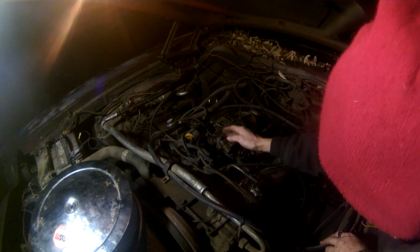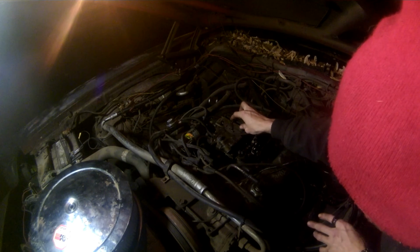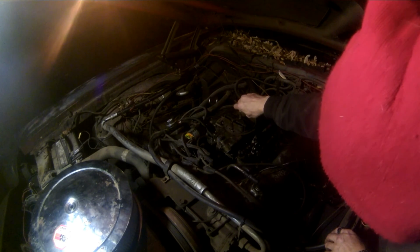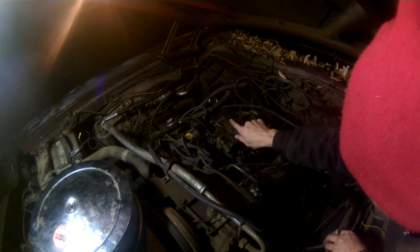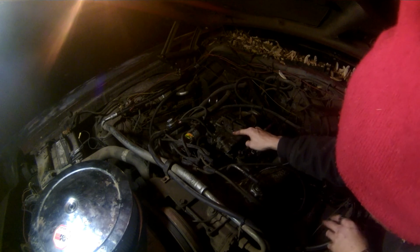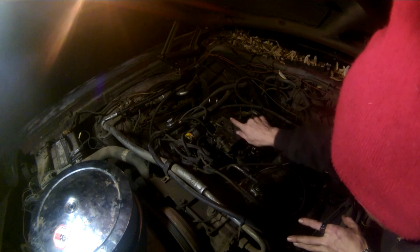And then what happens is that fuel not only spills up in here, so you get surging and flooding when you step on the accelerator, but also at idle, say you open up a vacuum leak with your vacuum booster by pushing the brakes, the fuel level is coming up here and staying at the top of this float level, or wherever the float is, and it's causing this to not be able to drop air into that bowl and into the metering block to mix the fuel-air ratio correctly. So what's happening here is it's running extremely rich because it can't get any air.